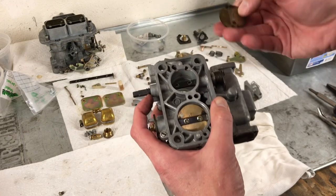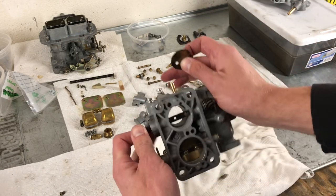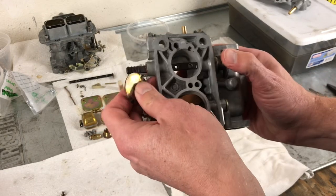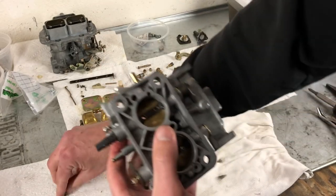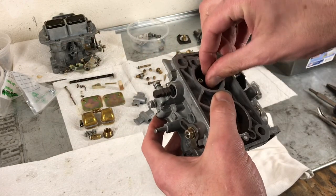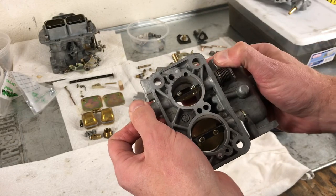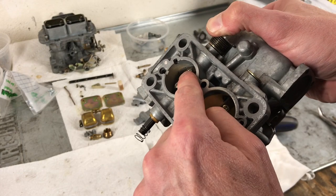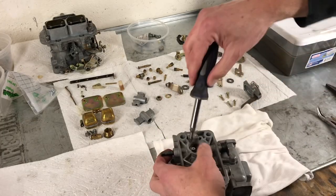We'll go ahead and do that in the same fashion, except in this case the 78 goes on the inside as well. With the large spring on the side it will be a little harder to turn, but same process to install. I'm going to lightly fit it, install the bolts, and check that the throttle plate has no gaps. Move it a few times, and you'll want to ensure that the tiny holes — you can see them right there — are covered when the throttle plate is closed. So we're good, and we'll tighten those down.